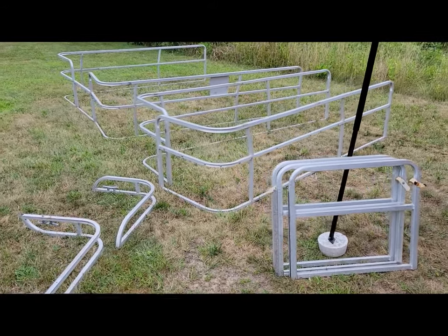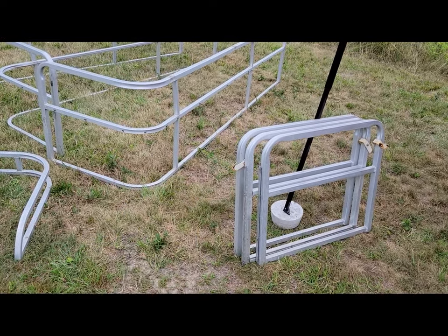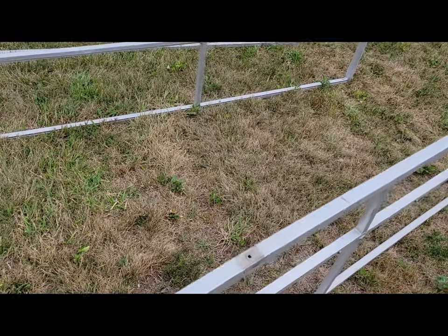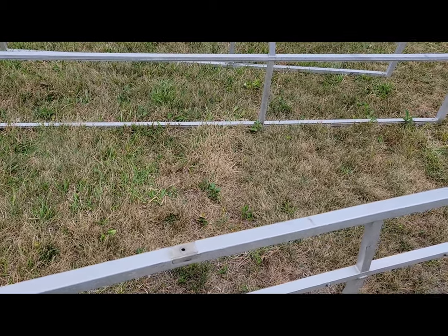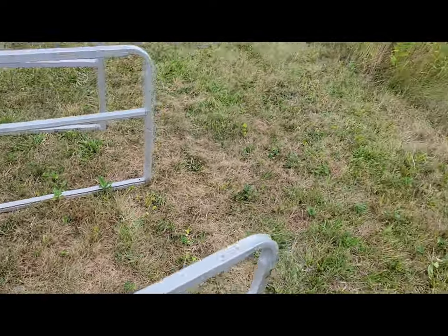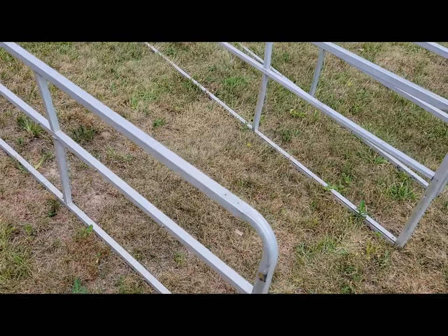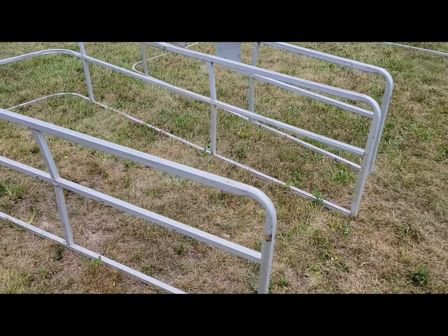There's all our fencing. What I'm going to do right now is hit it with a sanding sponge to get all the loose grime off before we hit it with a primer coat. I'm not anticipating this looking like a car paint job — it'll look good, and we're going to use actual car paint for the clear coat which will seal it in really well. It's not going to be perfectly smooth since I'm out in the middle of a field, but it's going to look good.